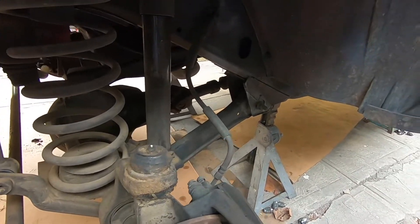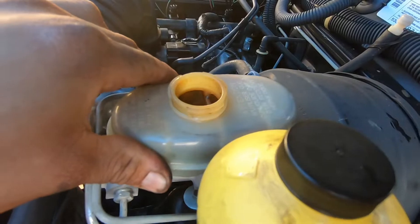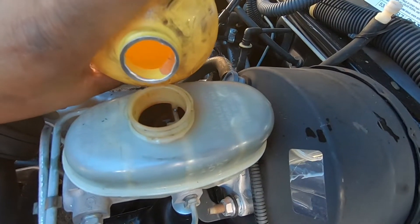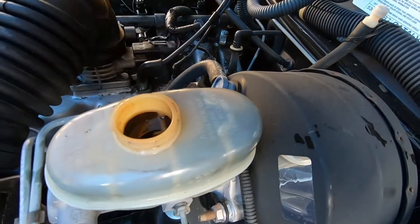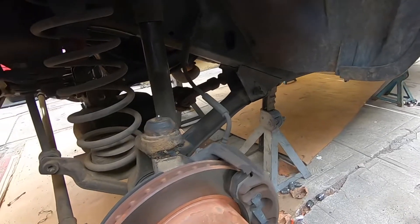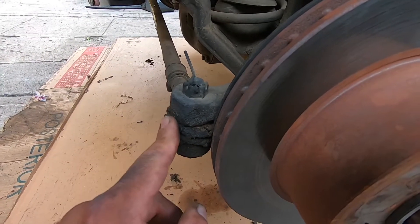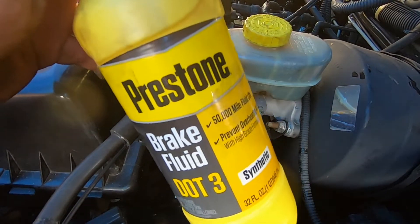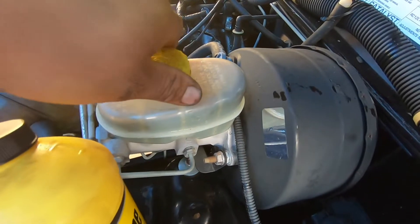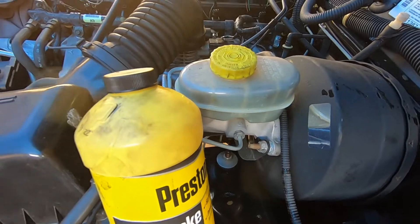Make sure you've topped off your master cylinder — if it's low, just top it off. This one just needs a little bit more. We're done with the brake flush. The fronts are three-eighths and the rears are 8mm bleeding screws. Notice that these tie rod boots are ripped, so they're gonna have to be replaced. This is the brake fluid we used — we basically went through the whole bottle and we're topped off, so we're done with this. That'll be it for this video. Make sure to follow us on Instagram at young_girl_o XC Films — I'll leave that in the description down below, and we'll catch you on the next one.